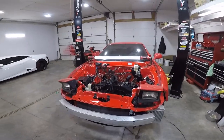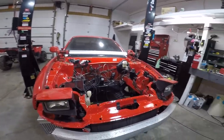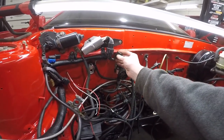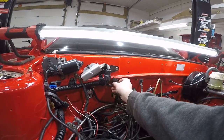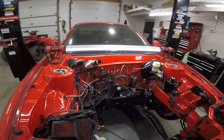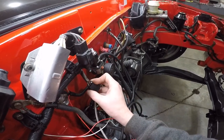Alright, back out here. I honestly don't know if this is a new video or not - this might just be the same video, me getting this ready to get the engine in. I have to hook up this boost solenoid to the ECU. This wire usually goes over here and plugs into your boost solenoids. Adrian's got a stock car and he's going to bring that bracket over so I can chase these wires. They're not the same color - they switch colors at this plug. Looking at the pictures it's like white, blue, and brown, but there's no solid white, no solid blue - there's blue and red - and definitely no brown.